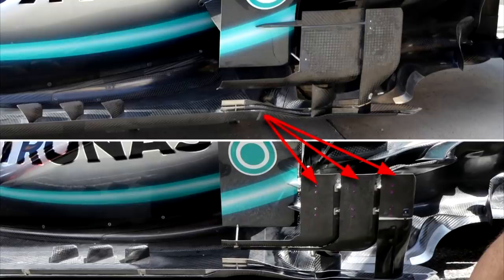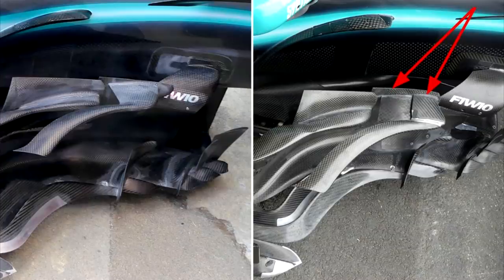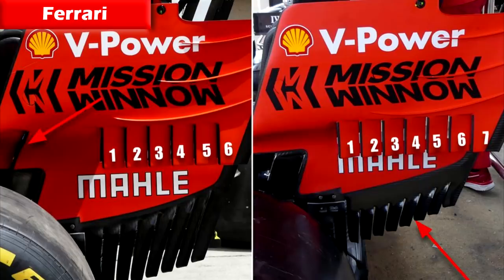They reverted to the old system for the race. Just a little bit of added detail to the barge board area — on that outer barge board they've added three little barge board elements in front of the other barge board, creating more downforce. That is what Mercedes are kings of at the moment. That Mercedes barge board area is incredibly complex, with boomerang wings hanging off the barge boards, which is quite remarkable. It's amazing to see how much it's changed from last season — last year it was made up of small cuts and parts, but this year they've gone with much larger parts.